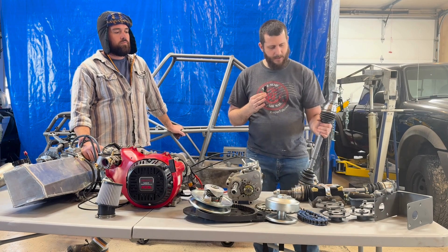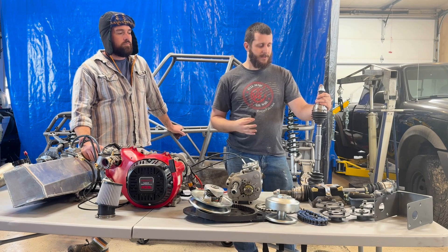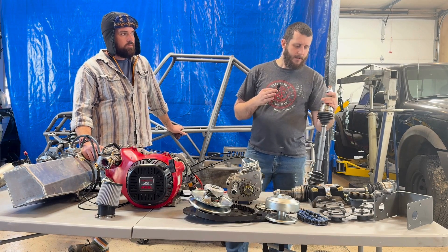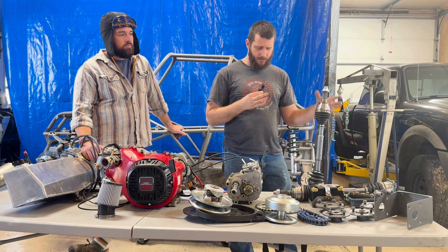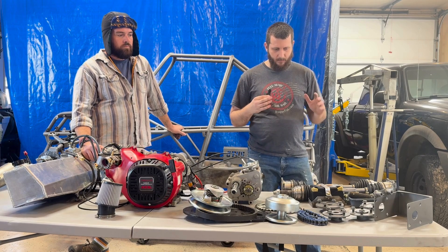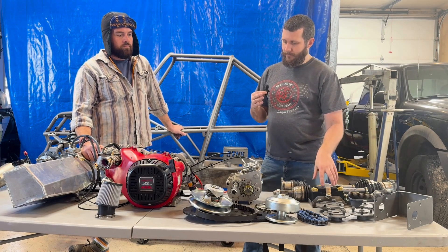The axles are Mazda Miata axles. If I had used them at stock length, the back end of the car would look a little funky and it would end up being excessively wide. So by the time I got it all mocked up to where I wanted it, I actually ended up cutting off an inch and a half of length on the shaft itself, then went and spliced that over with some inch and a quarter tube — welded inside, butted, then sleeved and welded again. We've also got a NOCO lipo battery. These are great — they don't weigh a whole lot and they have quite a bit of power from a very small size.